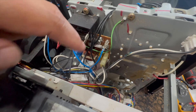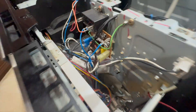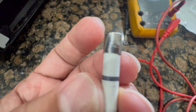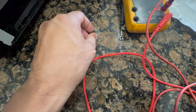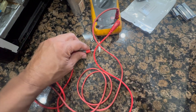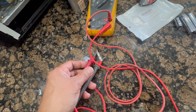You have to check both fuses — one is for the low voltage compartment and the other is for the high voltage. My high voltage fuse had gone bad. I took it out and it's a 20-amp, 250-volt fuse — you can read it right on the fuse. I tested it with a voltmeter for continuity and there was nothing ringing at all; it's supposed to buzz for continuity, so that confirmed the fuse was blown.